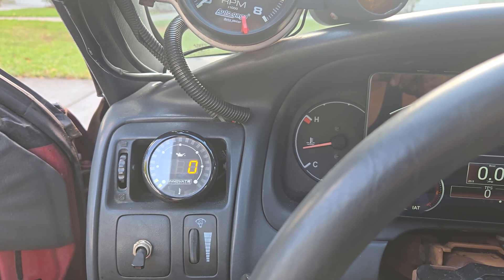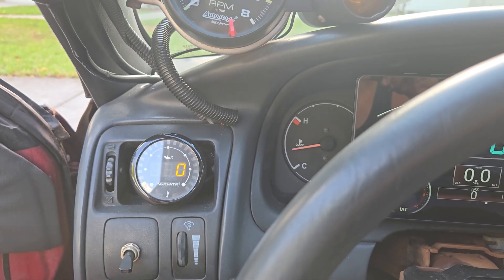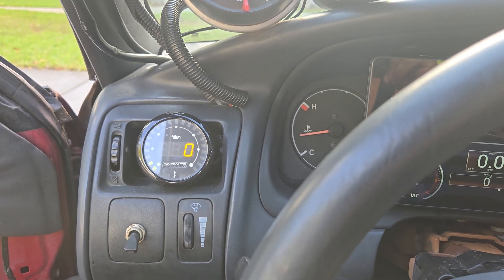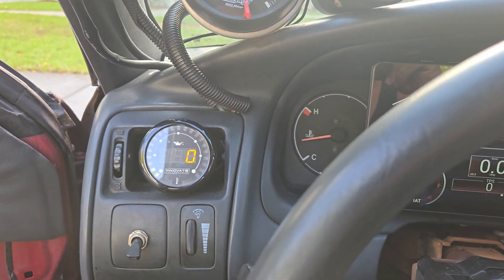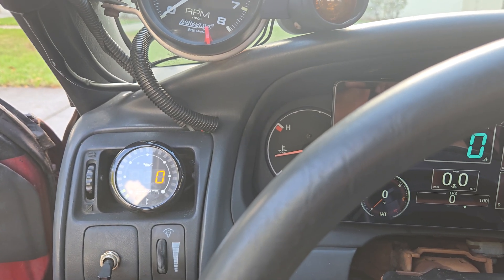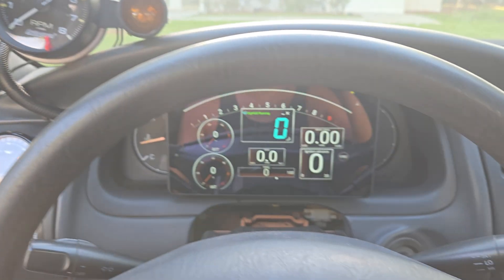So it's important that you hit the sweet spot. You might want to idle a little bit, then drive a little bit to get it warmed up. Or you might be a person who just starts driving right off the bat — the oil gets hot a lot quicker than idling and you get that right oil pressure you're looking for. Me, I typically wait till it gets in the mid 30s to maybe high 20s before I actually do pulls or street racing. I don't want to do it when it's like 65 PSI. I try to get it as hot as possible so your bearings are happy and there's no resistance in the oil flow.